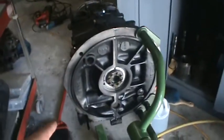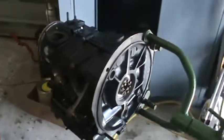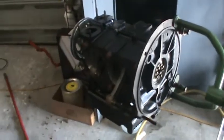So I got to get some studs and stuff for this one. I got my spacers — they put my jugs down there, so I got them on the jugs. I got to put the rings on there and hone those cylinders one more time. This one's getting close to being done, believe it or not.